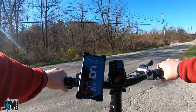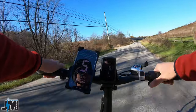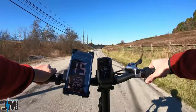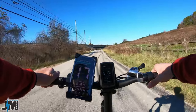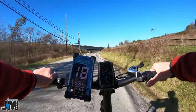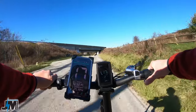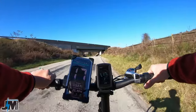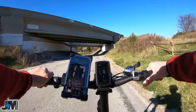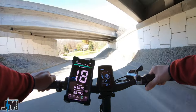Let's try this straight stretch with PAS 2 and see what kind of speed we get. Fairly level here, maybe just a slight incline. I believe 2 was at 70%, and you can see it's about 18 miles per hour on GPS — 17 now, and 17 on the display. Very accurate on the speed setting. I believe they have the tire size set at 23 inches. You could probably adjust that if needed to dial everything in perfectly, but it looks pretty good out of the box.